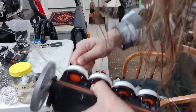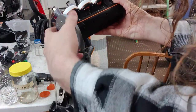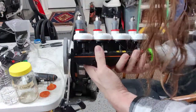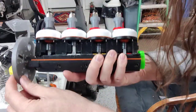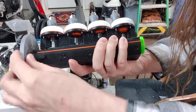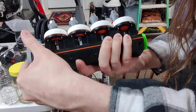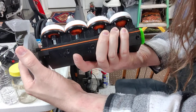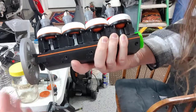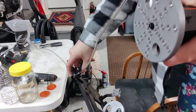Let's go ahead and try the first cylinder first. That's not the power stroke — this is a four-stroke engine. We're going to rotate it around until we get to the power stroke. Boom, right there. You can see it's timed pretty well on the first cylinder — as soon as it gets a little bit past top dead center, it activates, and that's what you want. Perfect timing on the first cylinder.